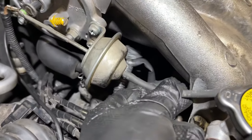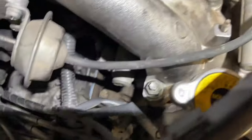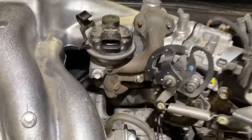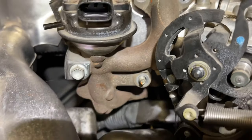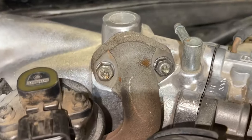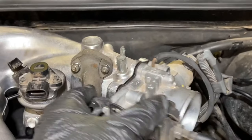There's a little tiny vacuum hose that goes on the end. We're going to take our 8mm Allen and 14mm socket and tighten down the nuts on the very ends, just like we took them off, and then the two bolts in the middle. There is a gasket under that intake manifold — make sure it was in place. Now we're coming back over here to put our four bolts — three nuts on the front and then the other two on the back for our EGR tube. The two in the back that were hard to see, you're going to have to do by feel — just follow that EGR tube up.